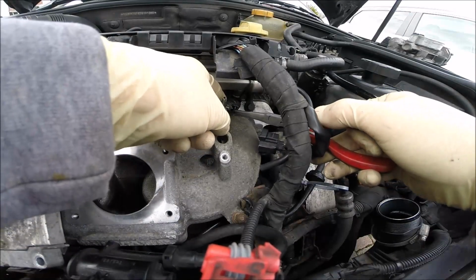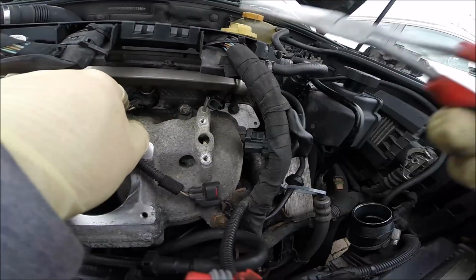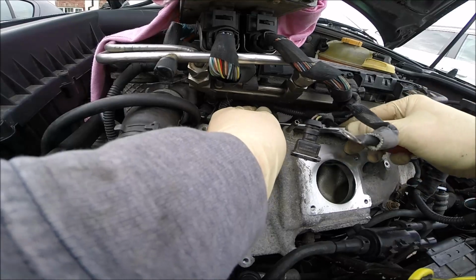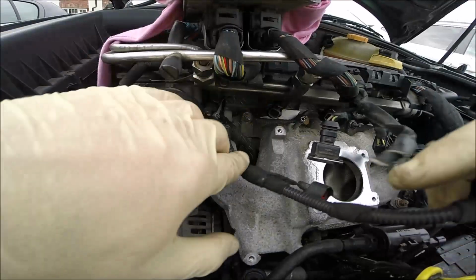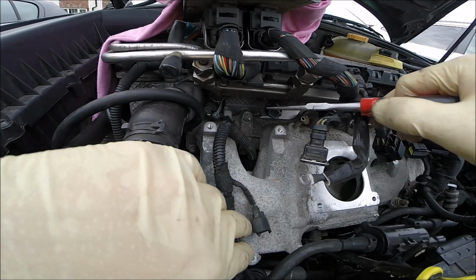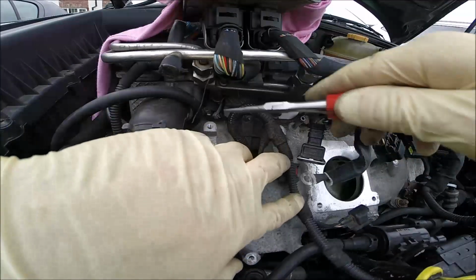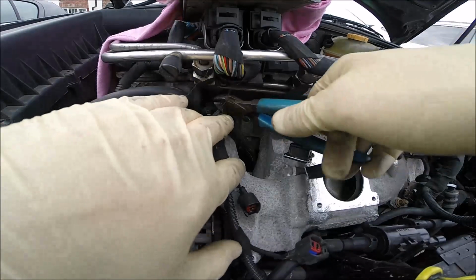So now we have to try to disconnect the injectors. Okay, the injector line is there. So here, when I removed the inlet manifold and changed the PCV valve, this element was actually broken, so I just held it with cable ties. I will do this again, no panic.